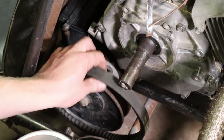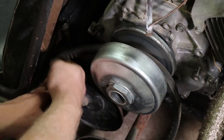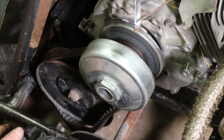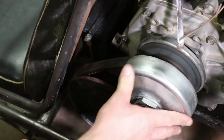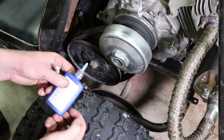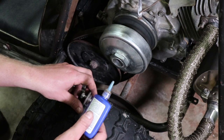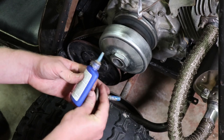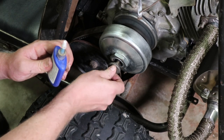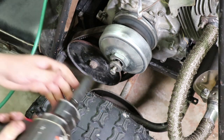Now, there's a right way to put the belt on, and that's drive unit first. Pop it on, then roll the cart forward with the drive unit like that. So that's how you should take it on and off — just rolling it on and off the driven unit. Without naming names, if you don't torque your bolt down to the proper torque specs, you should at least put some blue thread locker on there. It's temporary. You don't want to do red thread locker unless you plan on leaving that bolt on there forever, and you don't really need red thread locker at all with these smaller bolts.